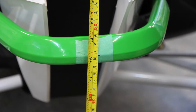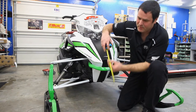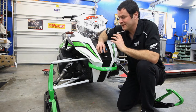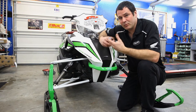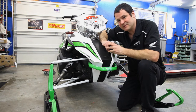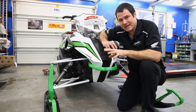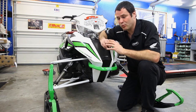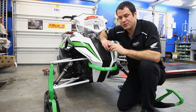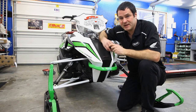We've got approximately 463 millimeters front bumper height. When we install the new Elka Stage 4 shock absorbers, now we have a reference number. We'll adjust the preload on the shocks until we replicate this setup for best handling. It doesn't mean the handling is the absolute best, but now the rider will be evaluating the shock absorbers and not accidentally evaluating a change we've made to the chassis.